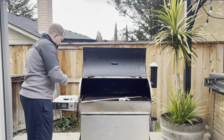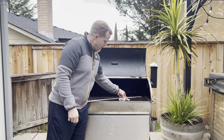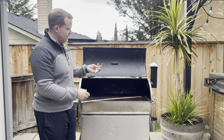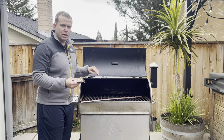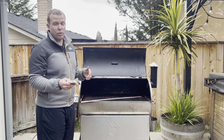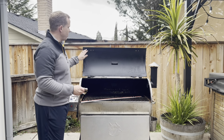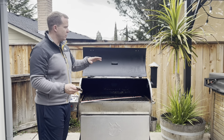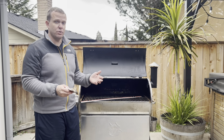Another note in the preparation for applying your drip edge, you can see here, we like to give the lid a quick wipe with just a simple household degreaser. That could be something like a moistened paper towel with a couple drops of Dawn dish soap on there, just to help cut any of the grease, smoke residue, things like that that'll already be adhered to your lid, assuming that your RT700's been in use for a while.